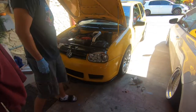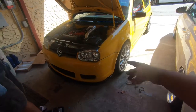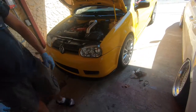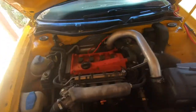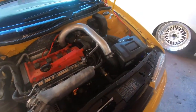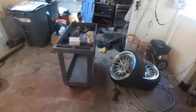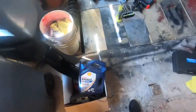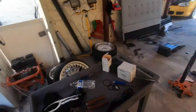Alright guys, so we'll be working on — no longer the 'rice rocket.' Some of you say it is because of the R bumper, but it's personal taste. So you have a 1.8 and you have that annoying beeping oil pressure sensor. At low RPM, you just start hearing beeping, and you've already replaced the pickup tube — it gets stuck, it gets clogged up.